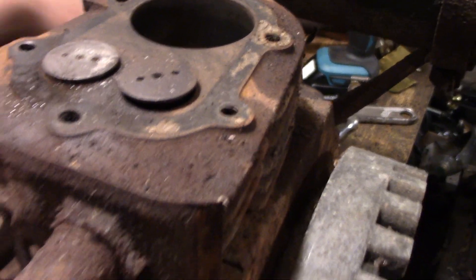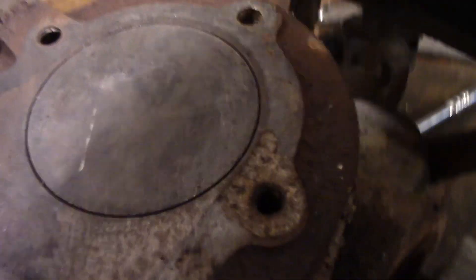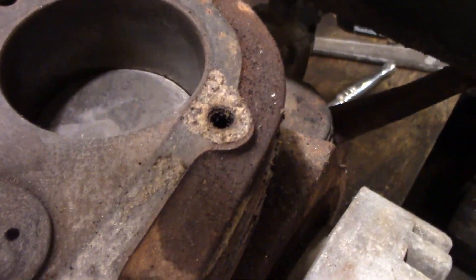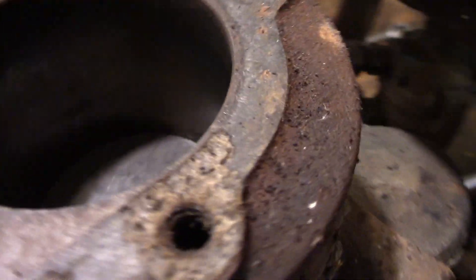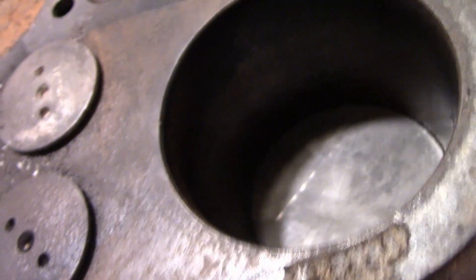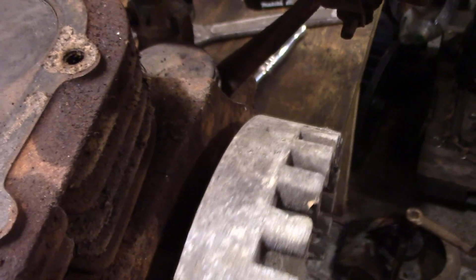The exhaust valve is really stuck - a lot of moisture has been getting up to that port. I cleaned up the piston and there's no stampings indicating it's oversized. The bore itself looks pretty clean - no scoring, not really any rust to speak of, just a little glazed. The piston doesn't have much slop in it, which is nice. Who knows, maybe this thing might actually be somewhat decent.